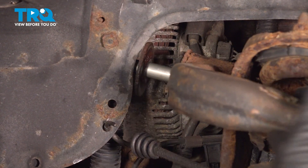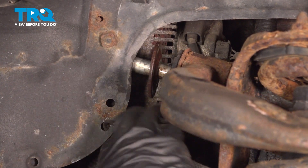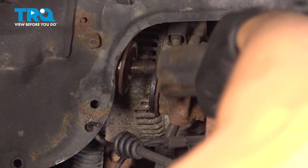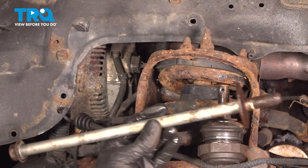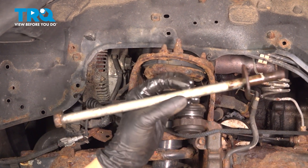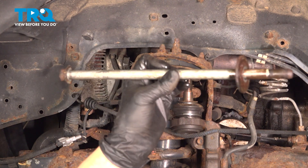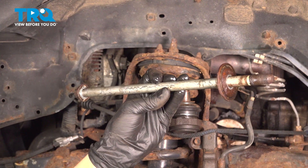At this point the control arm can move around. As you pull it through, make sure this washer stays because it's not going to clear otherwise. There's the control arm — you can just slide it off. Now take your bolt out. As you can see, it's extremely long. Inspect it because a lot of times they do rust out on the shank of the bolt. If they are damaged, rotted, or in poor condition, replace it from the manufacturer. If it's in good condition like this one, just clean up the threads and reinstall it.